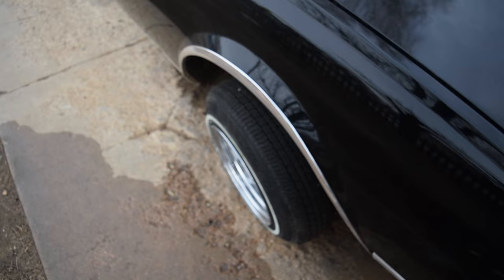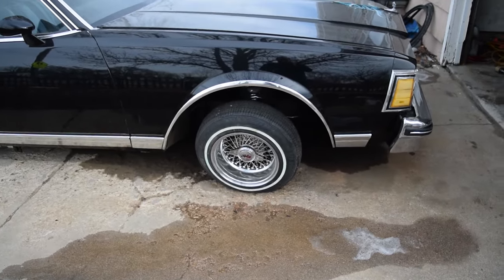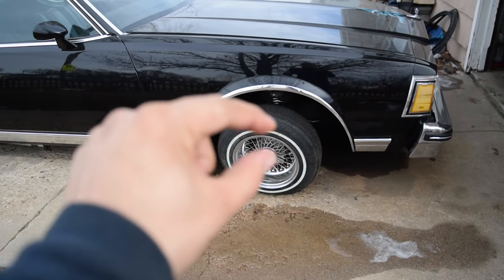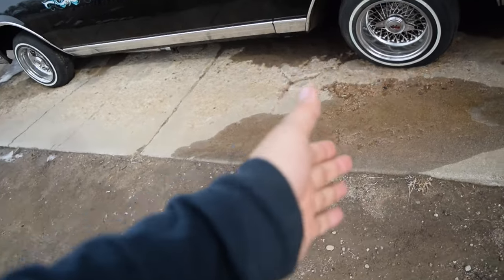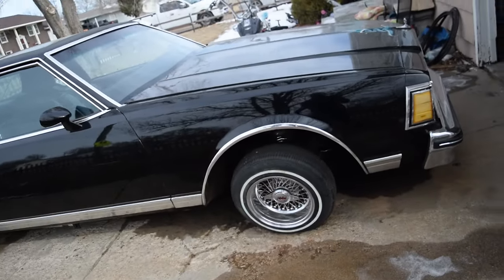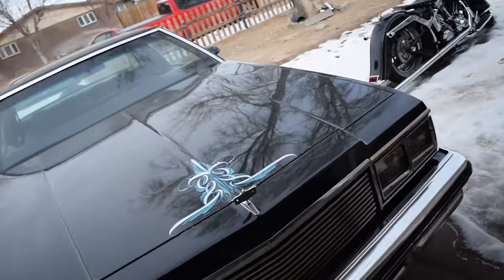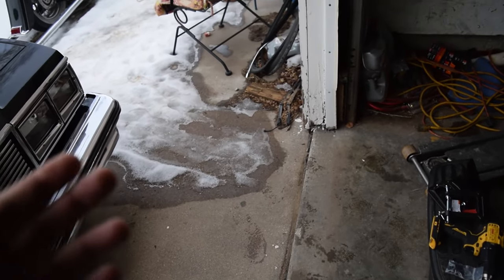What we're going to do first, I'm going to go ahead and take some measurements. This is all the way down on our passenger side here, so we're going to measure it from the top of the fender down to the floor. Then we're going to pick it all the way up and measure the same distance. After we swap our ball joints, we'll be able to see if we're actually getting more travel. I think we will. Stay tuned for that.